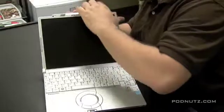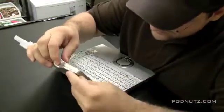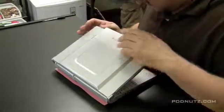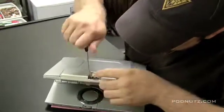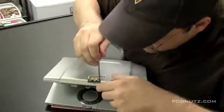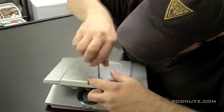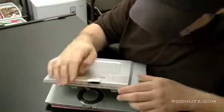After removing those nubs carefully, you'll see the screws you have to take off. Now we'll see if the screen will come apart — these Panasonic Toughbooks seem pretty tough and don't come apart that easy. I did discover a little trapdoor, you could call it, covering two screws. We'll take these out and see if that helps us in our quest to get the screen cover off. By removing those two screws, now we're getting somewhere.